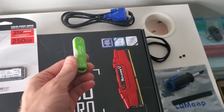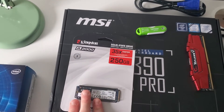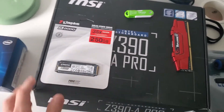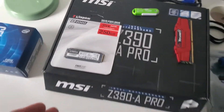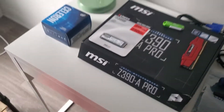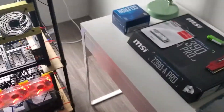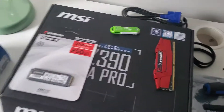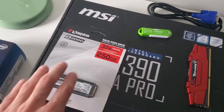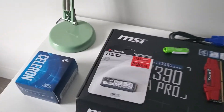This is just a USB with Windows on it — I'll probably start off with Windows and maybe go to Hive OS later. The last piece I had to purchase was this M.2 SSD. The reason I went with the M.2 versus a normal SATA SSD is to save power and avoid the data cable that goes to a physical SATA drive. I know you can get an adapter for M.2 to run an additional GPU, but it's going in a 6 GPU beta frame so I don't care about running 7. It was only $10 more than the equivalent SATA version, so to me that's $10 well spent.